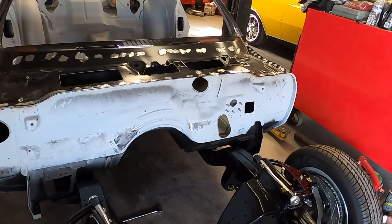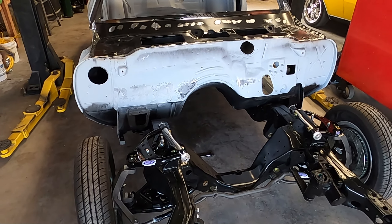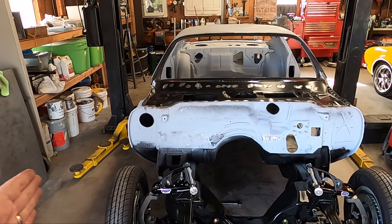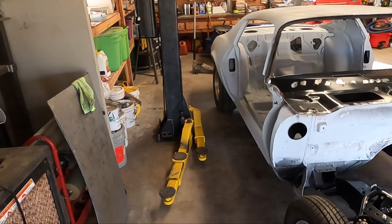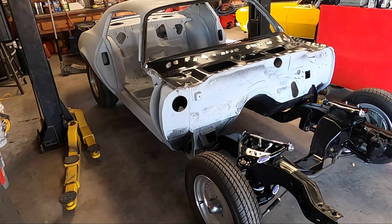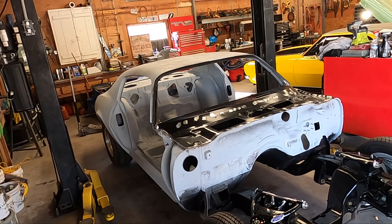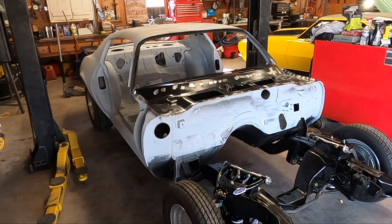We got the subframe connectors in place, all bolted. We did a few measurements — we believe the subframe is off about a quarter to half inch, so we'll have to loosen it all up, reposition, and get measurements dialed in. The nice thing is the alignment from side to side and how far the tires are out is about dead nuts. It's definitely sitting a lot lower than it was, which is good, but we'll have no idea how the stance is until we have the real wheels and tires on with all the weight in the car. The motor will drop the front end a bit and the rear seats, gas tank, and everything will drop the rear.